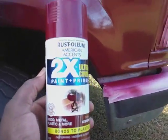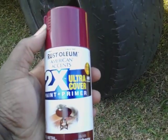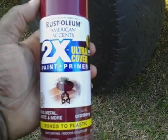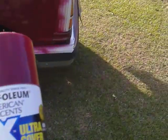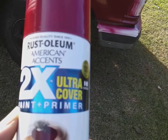I just want to kind of give you guys an idea of what it's gonna look like, what the color is, how it's gonna dry up, what kind of shine it's gonna have. As you can see it's got a typical shine. After about 30 days you can put a light coat of carnauba wax on it — that's typical shine man, not bad at all for a spray can paint. These are pretty good quality for four dollars a can. You can probably do this whole truck with about 12 cans — probably run you about 60 dollars.